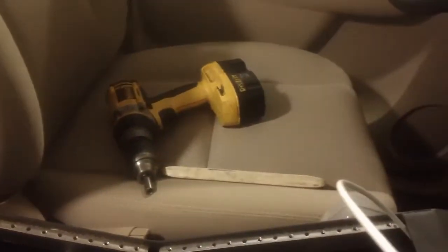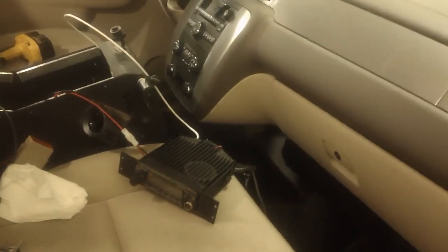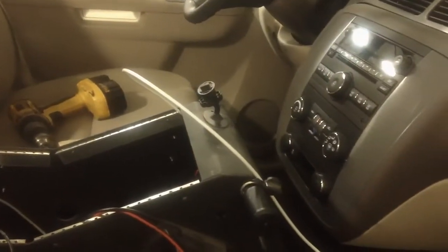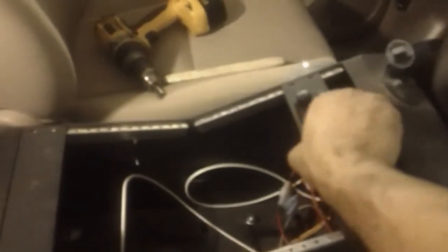If I go to the front cab, there's my ham radio powered up and the connector I just made is hooked up. I also hooked up the 12 volt accessory cigarette lighter connector. Now I'll turn off the ignition completely — after a few seconds everything should turn off. I can see my daytime running lights still on, then after about 30 seconds the radio went off, the headlights went off, and the accessory cigarette lighter went off. I know for sure my accessory switch and distribution panel in the back are working. This radio is ready to be the first one placed into service.